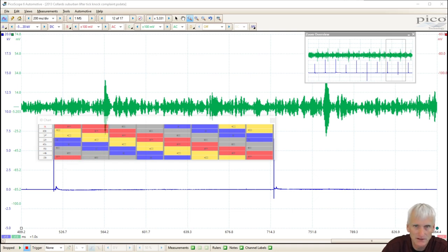Now, it just so happens that cylinders 1, 7, 4, and 6 are the displacement on demand, or DOD, cylinders. And we know that these DOD lifters seem to have some issues, and this vehicle I think had 140,000 miles, so I would probably go in that direction, look at these displacement on demand lifters and probably give them a change. The customer wasn't really that concerned about it, so I guess they'll just have to keep their eye on it, or their ear on it, and see if it gets any worse. If it does, that's the direction that we would go with it.